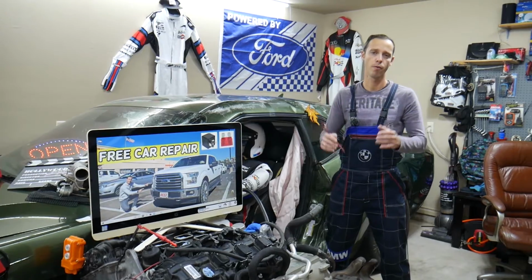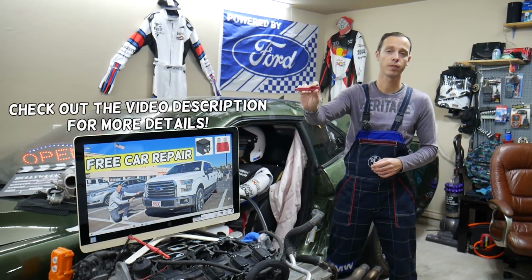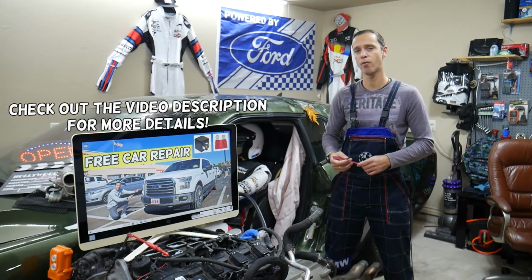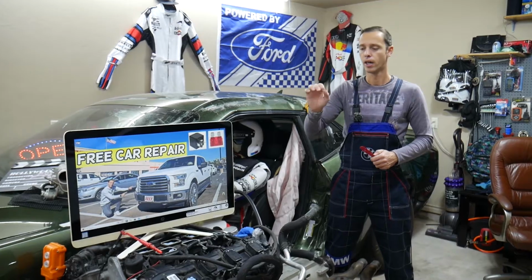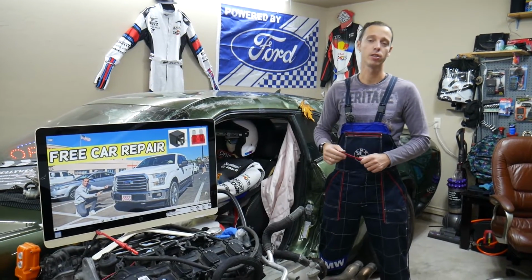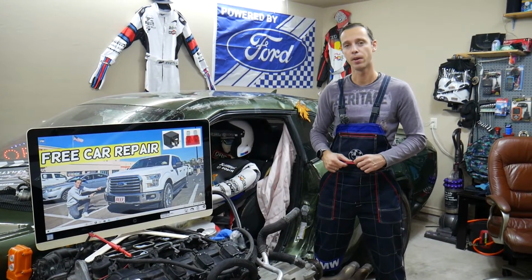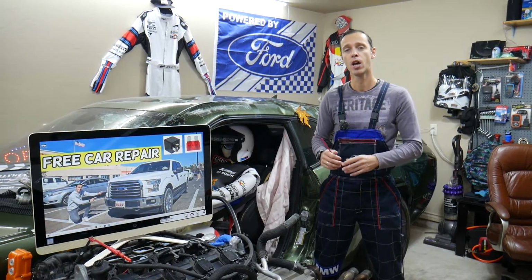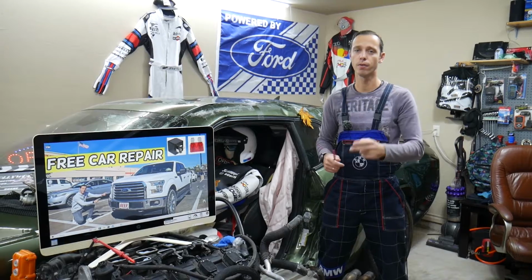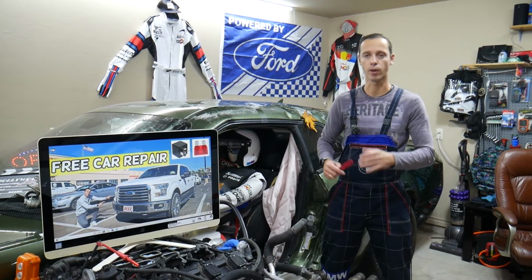Today will be a super helpful video, guys. To any of you having a Ford F-150, I'm talking about that generation from year 2015, 16 and 17. If you have one of those and your dash control switches, okay, do not work, this is known as the FCIM switches, guys. Stay with us, we'll explain where the fuse is located. You need to check that fuse. You may have two fuses in two different fuse boxes that you will need to check. All that will be covered today.